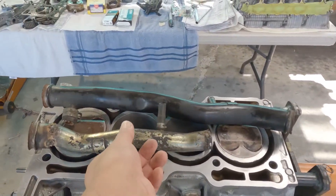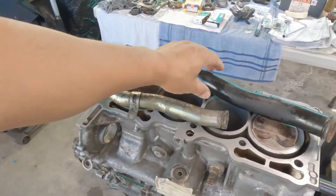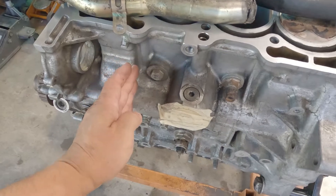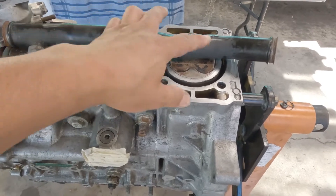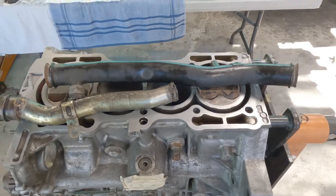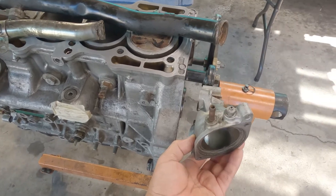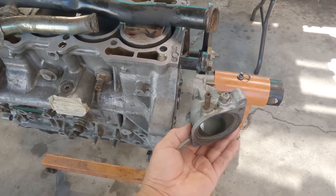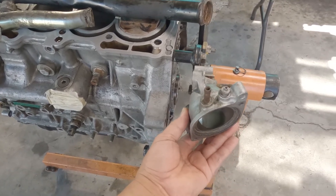For water cooling, you need F23 cooling lines. Just mock it up with the H22, and it's up to you where you want to cut it — either here or here. Simply use a rubber hose to connect them with two clamps, or you can weld it. You're going to be using an H22 thermostat housing from 1992 to 2001 — H22A or H22A4 — they're all the same. So you need a Honda Prelude thermostat housing.